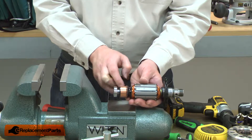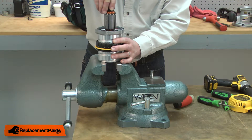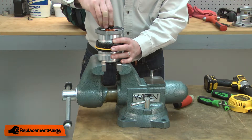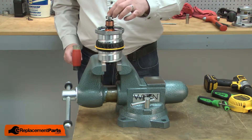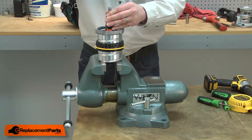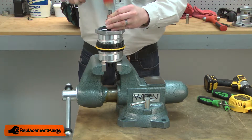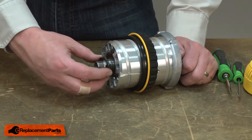There's no shoulder to stop the bearing on this armature shaft. Now I'll reinstall the armature into the motor housing. I align it with the lower bearing, and again I'll use a socket on the end of the armature shaft and a mallet to set it into the bearing, and I'll reinstall the retaining ring.